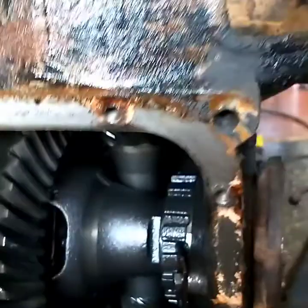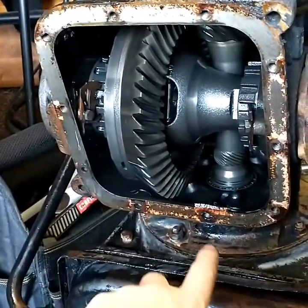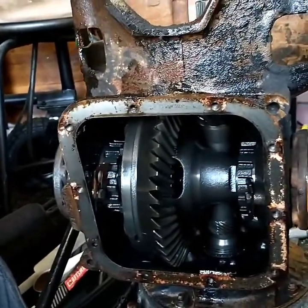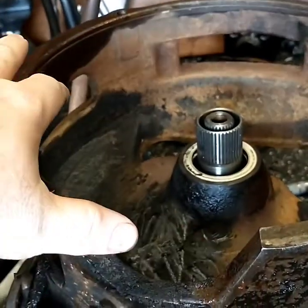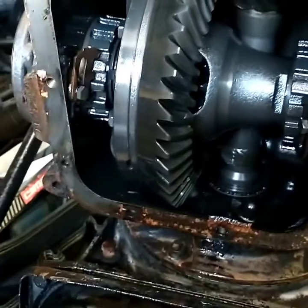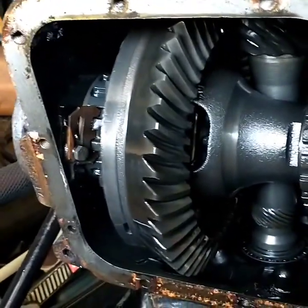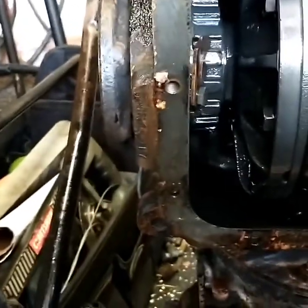We've got the side gear adjustments — they look tight. I need to replace the seals on the outside. We have to separate the heavy diff housing from the actual transmission because there are seals on the other side in between here that we have to replace. We're not rebuilding this, just trying to get seals and gaskets in it. It didn't look like anything was really leaking bad — I suspect it was leaking a little because you can see witness marks of grease being thrown this way. The pan gasket was not leaking, had fluid in it, looked okay. The pattern doesn't look too bad — doesn't look crazy worn out, and nothing's blue from excessive heat.